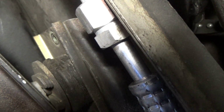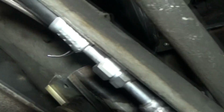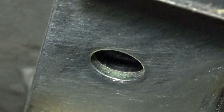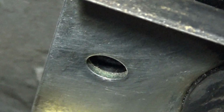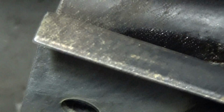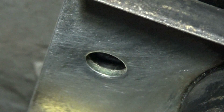So I'm just going to apply some heavy duty cleaner to it, and maybe sand it down a little bit to get rid of some of the stuff there. Okay, so I was able to clean that area up pretty good. That's what it should look like before you connect a new ground wire to it. So I used some sandpaper, sanded it down, used some heavy duty electrical cleaner, and then dried it up.